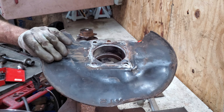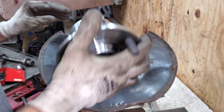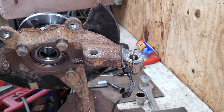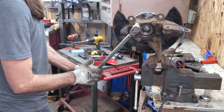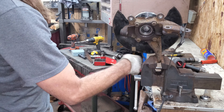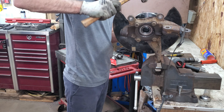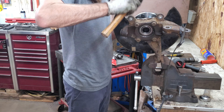Do the messed up backing plate. Do the Chinese wheel bearing. Oh, it went in the hole. These hub bolts get torqued to 72 foot-pounds. I went in a circle and torqued them down a bunch just to make sure everything's squished really good. This looks special - I don't know how that's supposed to look but it'll work like that.